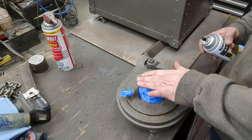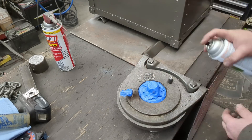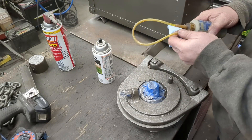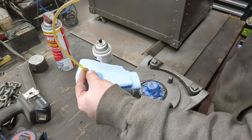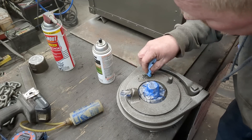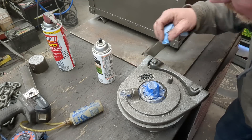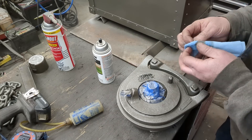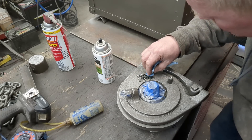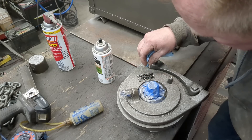You see this right here? I'm going to paint over it because you get a better finish versus taping it off. Now, gasoline doesn't harm virtually any decals or the paint on them — acetone will, but gasoline won't. I just take gasoline and get a nice corner to my rag, and I'm able to touch the entire top surface of the decal. If you tape it off, you're going to end up with little spots, especially if you're changing colors. Versus just doing this — beautiful. Can you tell?